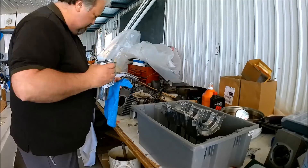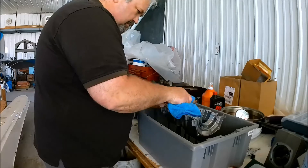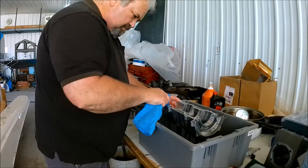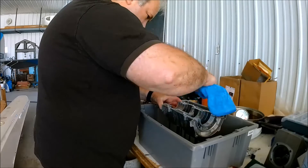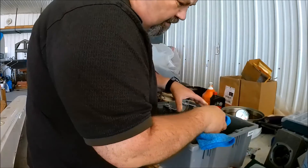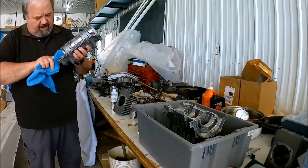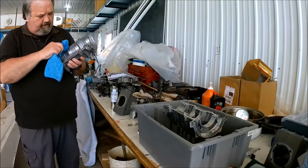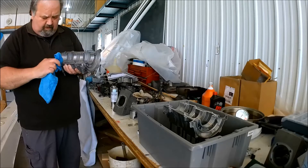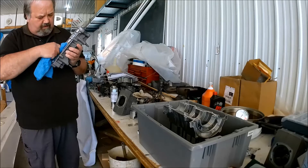The redo of this video is shortened greatly — it's only about 15 minutes long, half the length of the previous one that had really bad audio. I've decided to change things up; instead of fast-forwarding through sections, I just shortened the clips and left everything at normal speed. As you see here, I am cleaning the crankcase with MEK to remove all traces of grease and oils so that the sealant compound — the Loctite 518 — used to seal the two halves of the crankcase together has something clean and oil-free to adhere to.